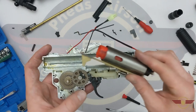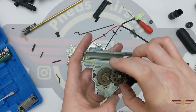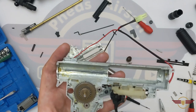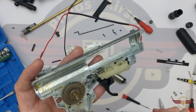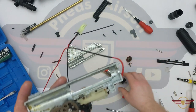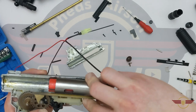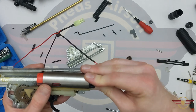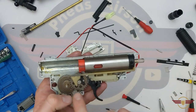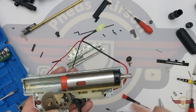So what I've done there is I've moved the teeth so they're away from the piston, because we don't want them engaging with the piston during the reassembly. The shimming doesn't look too bad. Let's have a quick look underneath — there are some signs of wear just on the inside of these teeth here, just onto the flat of the gear on the bottom row, but nothing terrible. The cutoff lever looks fairly good quality. The trigger block — not amazing, but again nothing's terrible quality, nothing horrific, except for maybe the air nozzle. For a hundred and five pounds, I am so impressed.